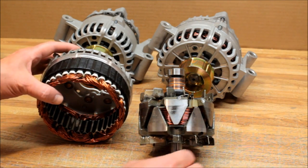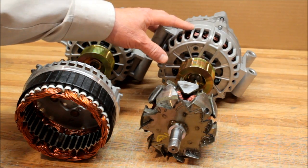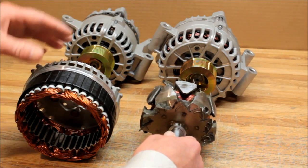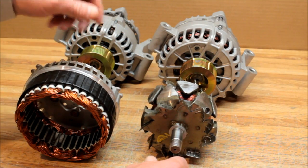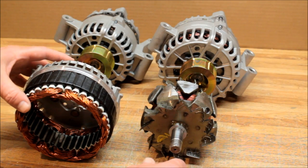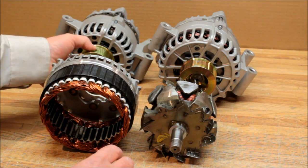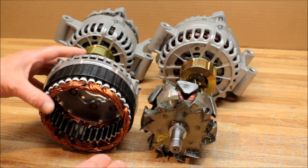This one's not too bad, but that's what you have to look out for. These large case units we offer are really good — they're built in the USA, top quality. You can't get the large case unit on these 99-and-up Ford trucks anywhere else; all you get is the 110 amp. We sell these outright with no core charge. Some people instead of using washers actually use a Dremel and grind out the cradle to make clearance, which works too. When you're done, the instructions say to give the alternator a spin to make sure it's turning freely before putting your belt on — if it's not turning freely, you've got a distorted alternator and you'll destroy it.